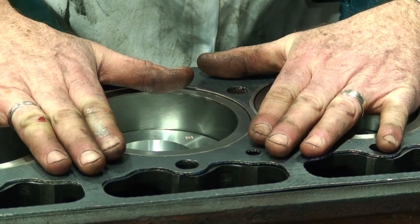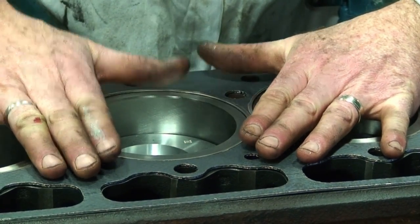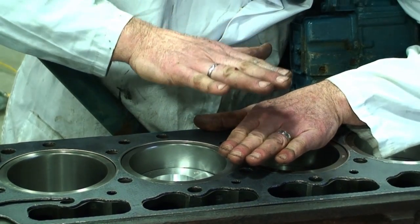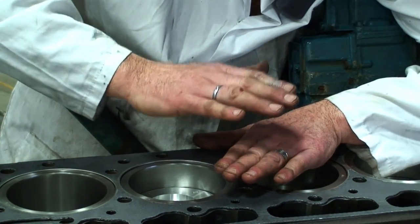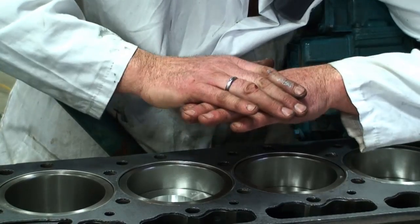So the gasket, another part of the characteristics of the composition of the gasket is compressibility. So we actually have an available amount of area in the gasket that we can compress it down. That's based on a manufacturer's design, how far it's going to come down based on the torque, the number of fasteners, and the type of material that it's mating against.